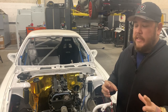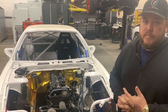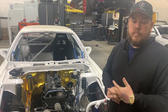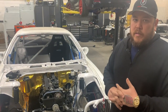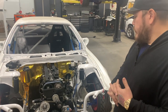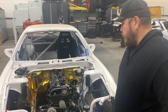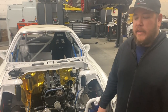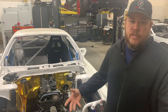This stems from old-school Japanese tuning culture - the idea that a thicker head gasket makes things safer was the technology they were using 20 to 30 years ago to bring compression down. That's not necessarily true today. We're looking at factory vehicles coming out with turbochargers at 10.5, 11, 11.5, even 12 to 1 compression. Direct injection plays a role too, like BMW's 335i. On a race car you have more tuning adjustability and can run better quality fuel, giving you more room for higher compression.